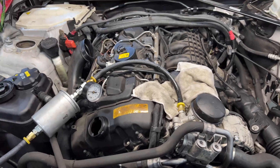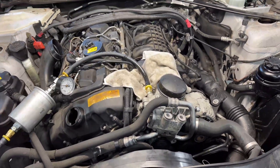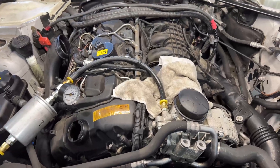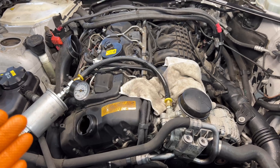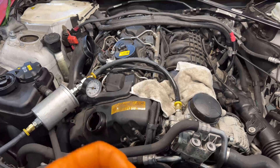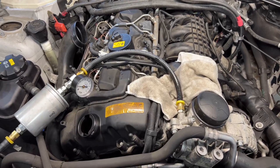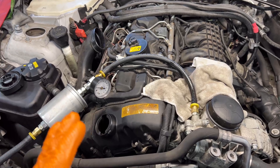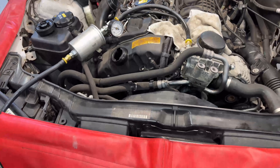I'm always thinking about this: let's say you're working on a car with 200,000 or 150,000 miles — is that engine even going to last the time it takes to spin it with no oil? Those bearings are going to get scratched and it might even seize the engine. I've seen that happen, and that's why BMW recommends doing this prime, because it's very common.